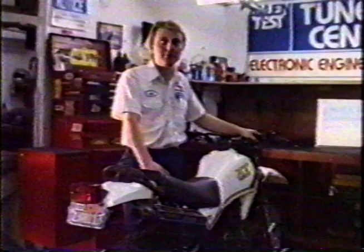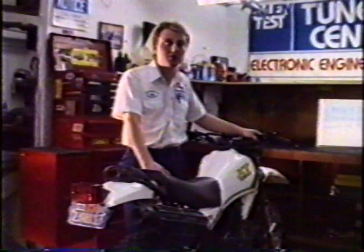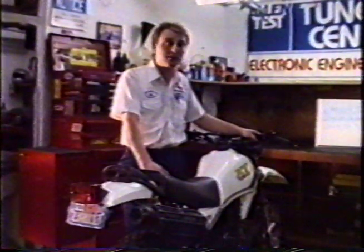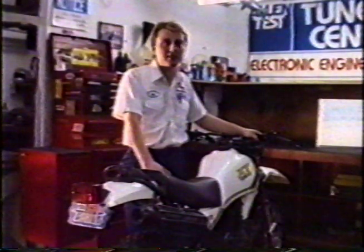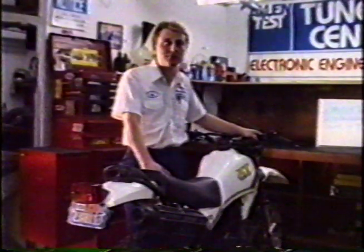When selecting a wheelie bike, you've got two basic options. As everyone knows, large 4-strokes are easier to learn on than small 2-strokes because the 4-stroke has lots of mellow power and also a lot of compression braking. You don't need the rear brake as much. Once you're good though, a lightweight 2-stroke is a lot easier to throw around, and the addition of a heavy flywheel can make it almost as easy to control as a large 4-stroke.